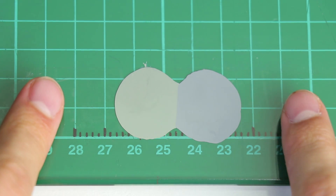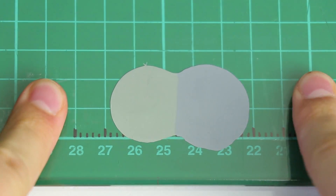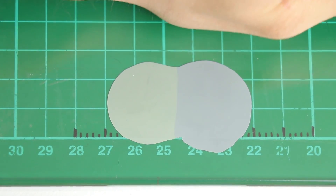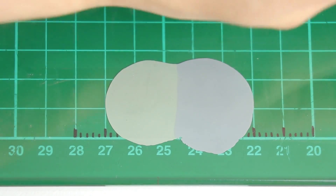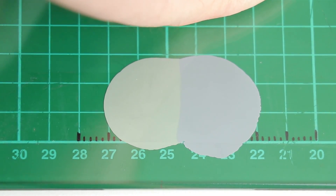With a fair amount of pressure, eventually leading up to me leaning on the glass panel, it looked like this. Accounting for me incorrectly sizing the amount of thermal paste used for each, they're really not that dissimilar in terms of spreadability. Perhaps MX4 spreads out a little more easily — it's clearly more spread out on the right, which is MX4.